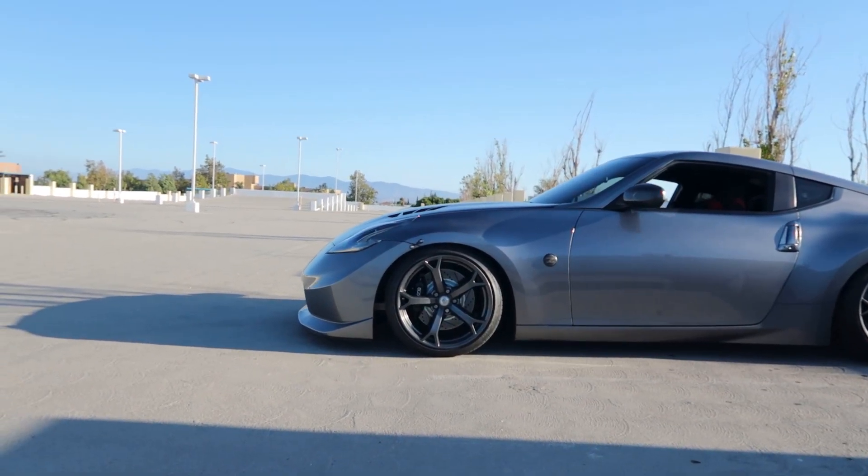Here's this side — boom. If you guys didn't know, I had a Boosted Performance kit. I haven't installed it yet, I know you guys are waiting — coming soon. It's just been way too hot. So it came with an oil cooler. The oil cooler I had previously I took off because the wires were all ripped and that's where it was leaking from. So I completely swapped out the whole oil cooler. I swapped it with the one that came with the Boosted Performance kit — it's way bigger too. I bought like ten quarts of 5W and I have like two quarts left — it almost took seven and a half quarts. Before it was six and a half. That's a lot of oil y'all.